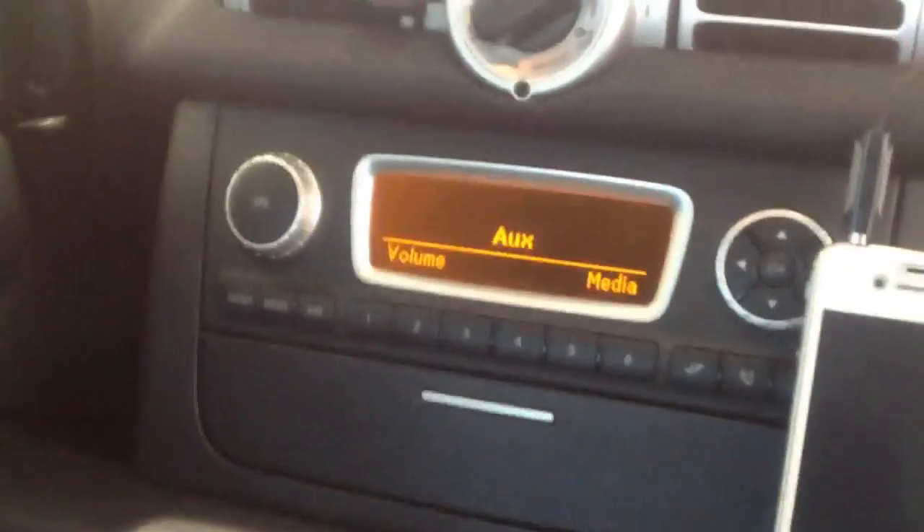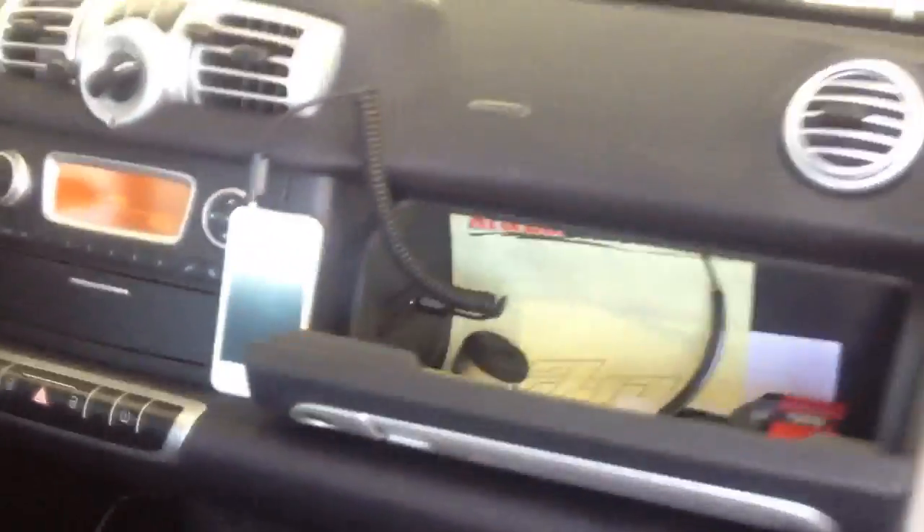So I'll bring you inside and show you what we've done. The car does look totally factory — factory stereo. We went ahead and used the factory tweeter location up in the dash. This was a base model vehicle which did not have speakers. We've gone ahead and added the tweeters in the factory locations as well as installed the Focal 6.5 inch mids behind the factory panels, and that's done from the outside of the vehicle.